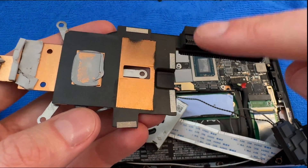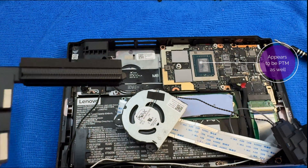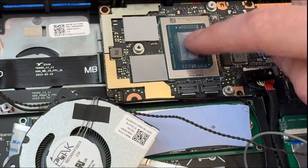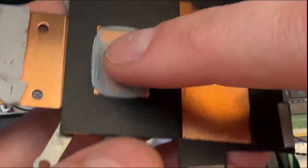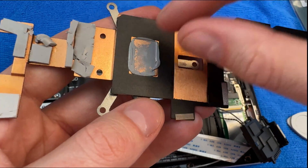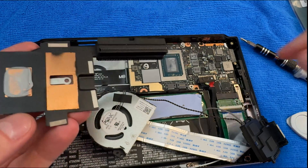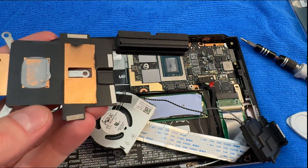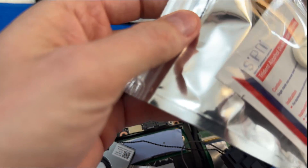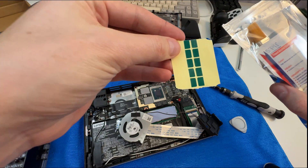There's the paste — it's pretty dry. It looks like okay coverage, but there are actually some dead zones in there. That little bit that's missing was on the heatsink, so it doesn't look terribly miscovered. They didn't put much on, but I'll clean this off and repaste it. That alone might increase performance with better spread, but we'll try the PTM here — I just bought this off Amazon.